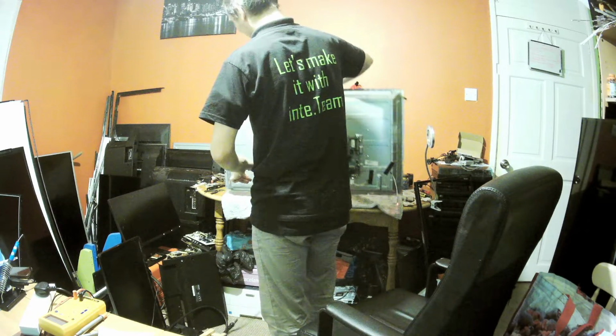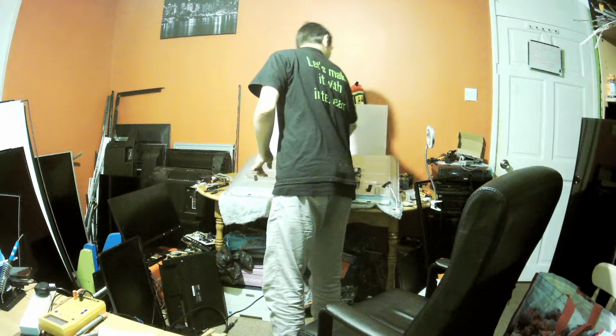I can assemble the TV. I've got different colors of those diodes, so I will assemble it and see if that will give me shadowing. If so, I'll have to open it and remove a whole lot of them. Unfortunately, that's the case. But I can say that before I was changing one diode here and there. Today I've swapped like 5 of them, so it's only 13 left, and it doesn't take me such a long time anymore.